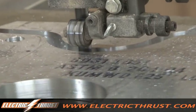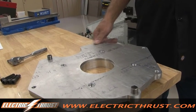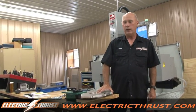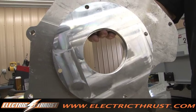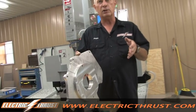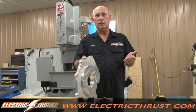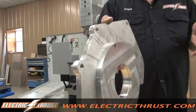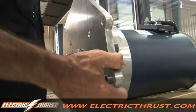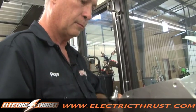This is the outcome over here. We created this flat plate from a DXF file, converted it to machine code, and machined out this plate which matches the transmission. After that we had to flip it over and make a spacer plate. The spacer plate is important because we needed to keep the same dimensional offset from the flywheel that was in the gas engine to the electric engine — that way we can have a good performing clutch. It's basically designed to slip fit over the electric motor, then we bolt it into place and bolt it to the motor.